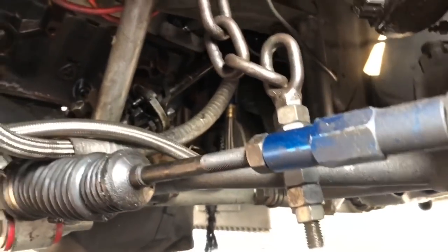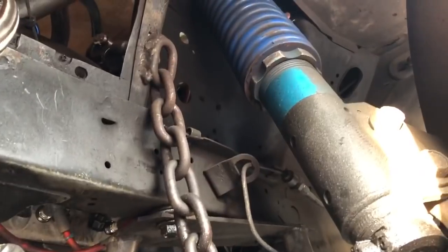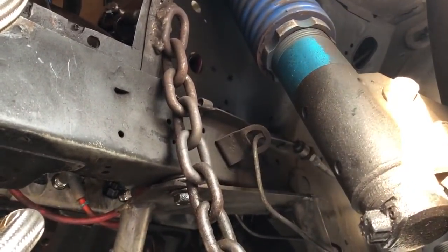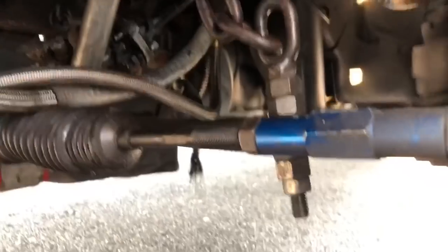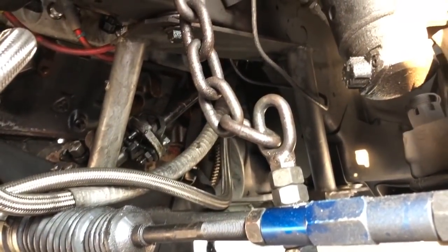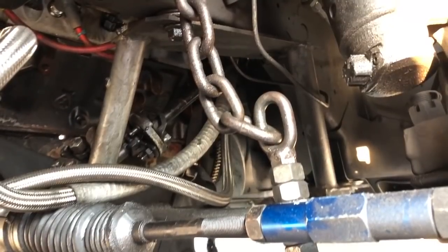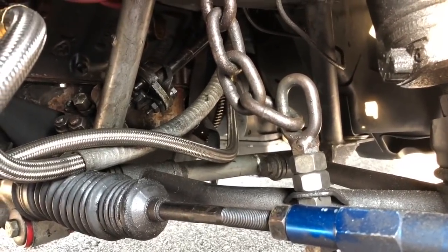My car — these are homemade — they just go through the control arm, and I just do it by the amount of nuts on the top. You can see the chain is just heavy-duty lock chain. It's probably a little over-built, but just welded to the frame up there. This is how much travel it has now for the front end — that's about two to two-and-a-half inches when it's going down track. So we're going to take it down to basically both of those nuts that are on top of the control arm, and then it'll reduce travel to about three-quarters of an inch.